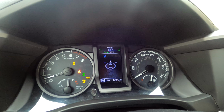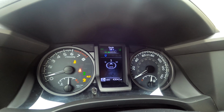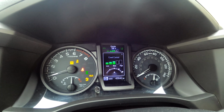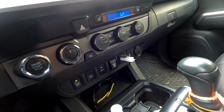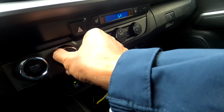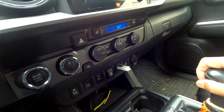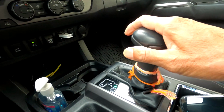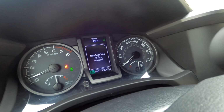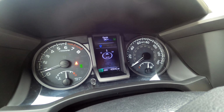going. This control is automatic by the system. You just control the power, the steering. That's what you do. Okay, how to turn it off? You go to the four-wheel drive, you push and turn it, and then you move to the neutral. Move this to neutral, and then you will deactivate it. After it's deactivated, then you can move to the two-wheel drive.